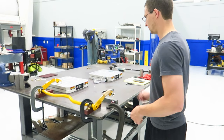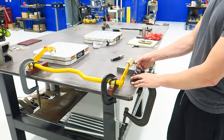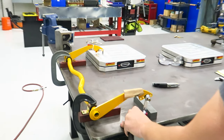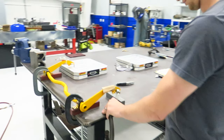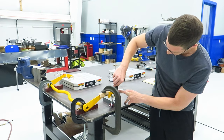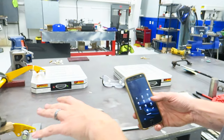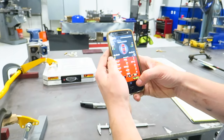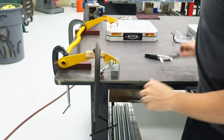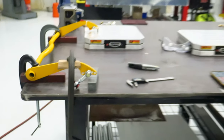So we're going to rate it using one of our scale pads — clamp it to the bench and push down on the arm to get one inch of displacement. We'll see the change in force and get an inch-pound rate for this bar. We got our clamp on, the gap is 1.5 inches. I zeroed the scale pad with a little preload to get any flex out of the system — we're at 46 pounds to start. After compressing to 0.502 inches displacement, we moved the bar one inch and we're up to 215.